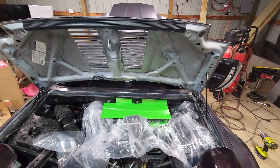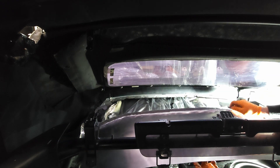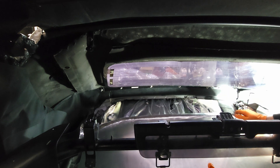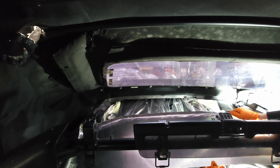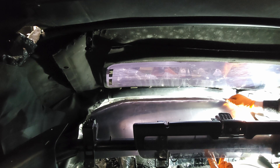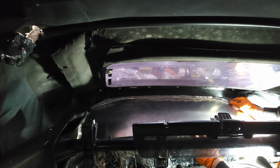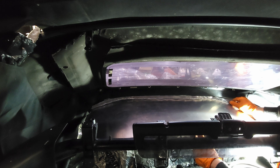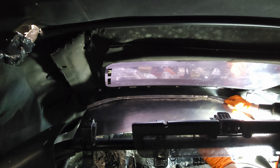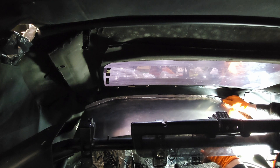There's the ugly little rain tray — mostly for function, not form. I'll end up having to take that piece and cut a little radius into it because the top part of the car seems to have a little curve and I didn't realize that going in. I was hoping I could manipulate the rectangle and make it work, but I had to cut the radius. Like I did the other one, I basically just hammered a lip on the edge of it. I plan on using self-tappers to hold it all in place, which will also give me pilot holes for making the riv-nuts. As I drill in the self-tappers I'm going to hammer it along the way to manipulate it to form the shape of the car — at least that's the plan.